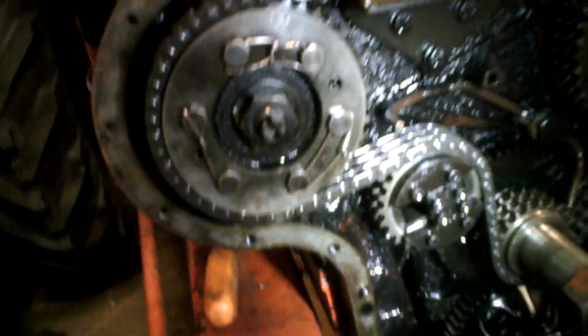So what it is — there are marks on the sprockets, which is a 0. I think you can see it; it's under that bolt. I'll point to it. There is a mark there, and there is another one on this sprocket — I called it a pulley, of course, it's a sprocket. There's one there, which is at the bottom, and the crankshaft one is of course on the keyway, which is underneath.